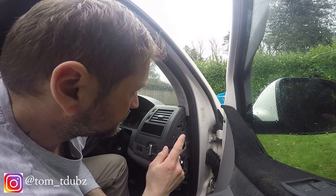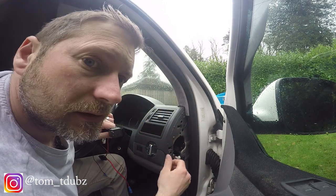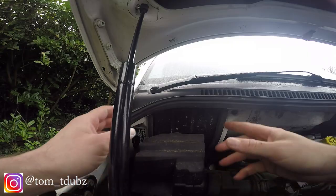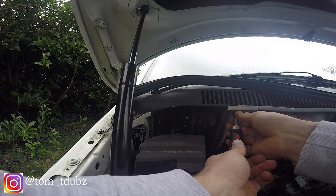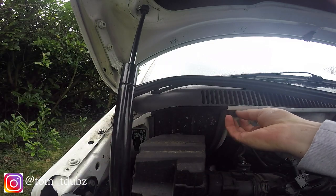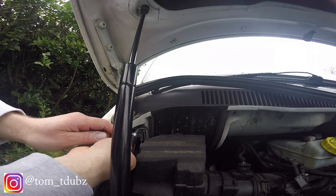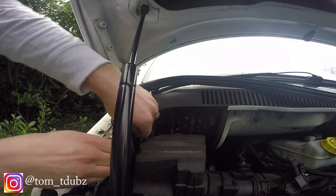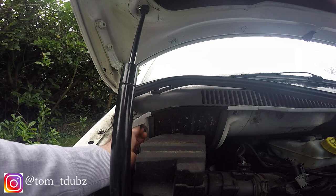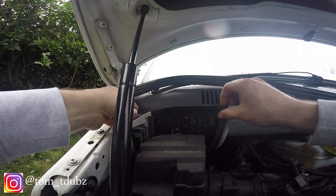The first thing we're going to do now is just have a look in the engine bay and see if we can gain access to the back of this. So this is what we're looking for — this access panel. It's two torx screws under there. I've got a T25, so I'm just going to whip that nut out, and then there's a second one just under here. I remember from doing the coilover video I can get this out without removing the airbox, but it's a bit fiddly.